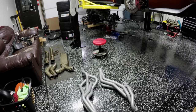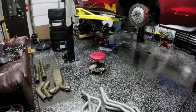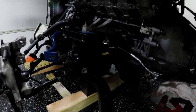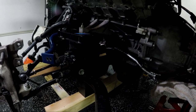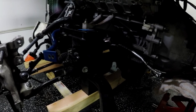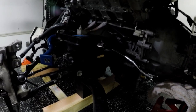I ended up going to remove the long tubes and found out you cannot get the long tubes out of the car with the engine still in it if you have the FP350S oil pan — the oil pan is just so wide down there. That little part that juts out extra compared to the standard oil pan gets in your way. I messed up the gaskets for the headers and made a huge mess, so I went ahead and just dropped the whole engine out of the car. I had two months between events, so I figured it was a good chance to look at things, see how they were wearing, and fix this header issue once and for all.